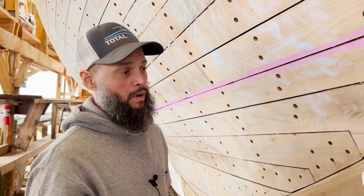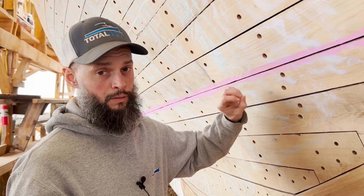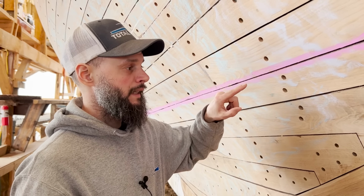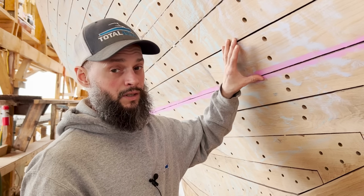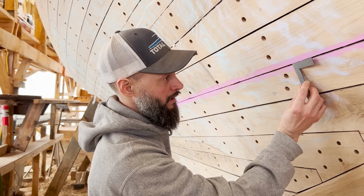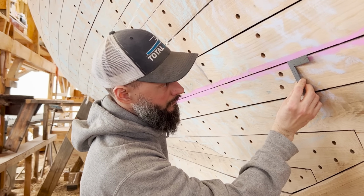Taking the boat out of the water every year is something that would be really hard for Arabella. She wouldn't handle it well because this oak planking is going to move and shrink and swell and move and shrink and swell, which stresses the fasteners, it stresses the frames, and it makes it so that these planks eventually get tired.